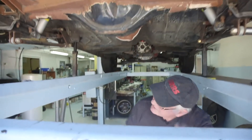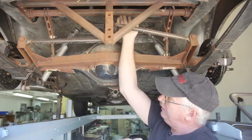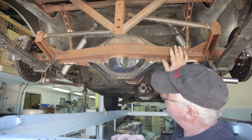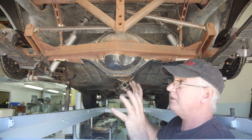You can see somebody's already started to build a custom rear end for this HK — a Watts linkage and a custom sway bar, narrowed axle housing, supposedly reinforced, not necessarily straight, and not correcting all its geometry.